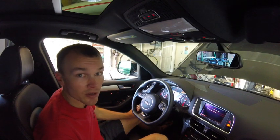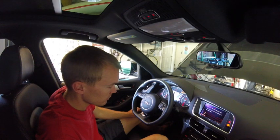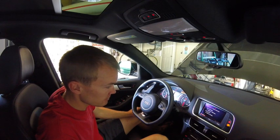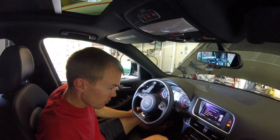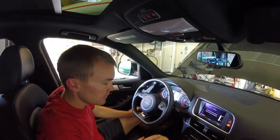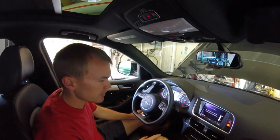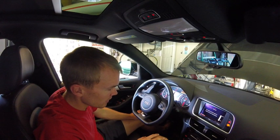So what we're going to do is go down and reset the oil change interval now that we've changed the oil. We'll confirm yes, we're ready to change it. So now we're good for 10,000 miles, according to the car. Now we're going to go back to the last screen and you can scroll up to oil level. And you can see here, interestingly, it was actually down a little lower before. Now it's got me up to the max. So it's giving us a reading there.